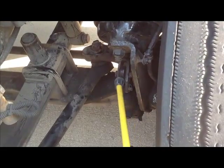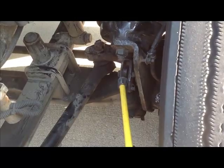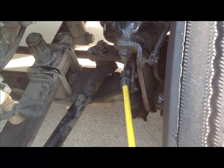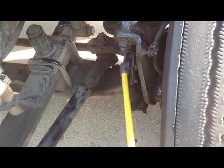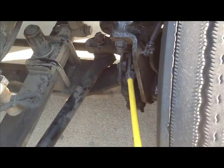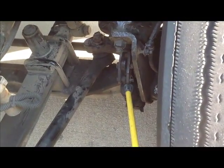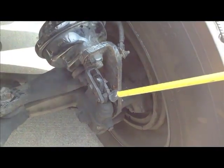It is the thing that you learned in the manual: no more than 1 inch of pull with the brakes released. But we're going to say this is our slack adjuster. There are no missing parts or pieces, and it has the cotter pin in place, and there is no more than 1 inch of pull with the brakes released. Stop. This is our slack adjuster. I believe that's where we were at.